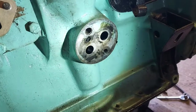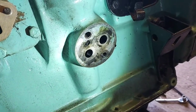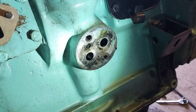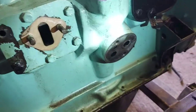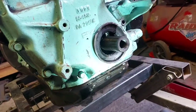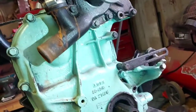Unless you've got marks on the end of the camshaft — which I've done a couple of these and I've never had one with marks on it. I'll get this timing case off, that's simple enough. All the bolts — don't forget the three that hold the front of the pan on, the oil pan.